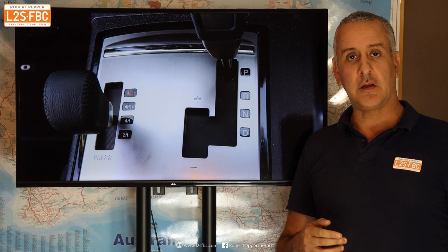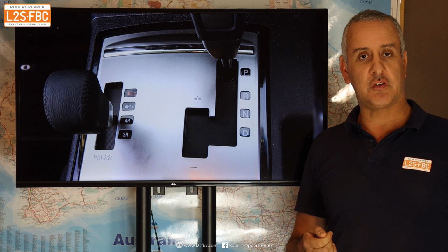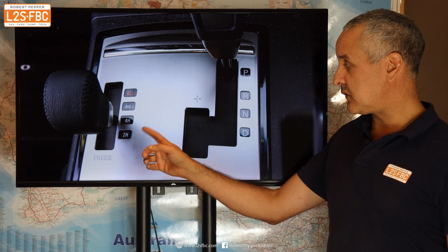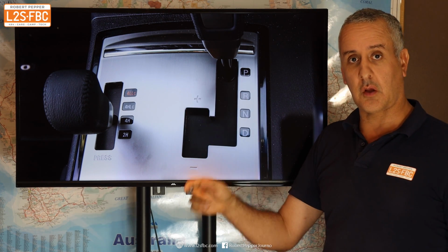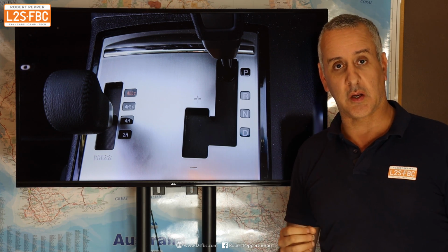It's the same vehicle, and the same system also applies to the Pajero IO, otherwise known as the Pinin, and the Mitsubishi Triton, most variants of it anyway, otherwise known as the L200. Anyway, there's 4 modes. There's 2-wheel drive, 4-wheel drive, centre diff unlocked, 4-wheel drive, centre diff locked, and 4-wheel drive, centre diff locked and low range. I recommend you use only the top 3 modes, and this is why.